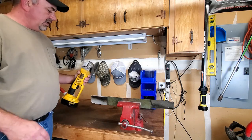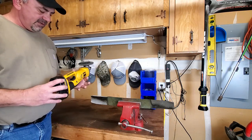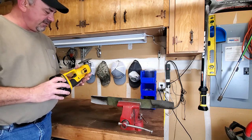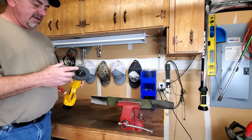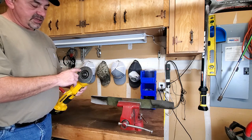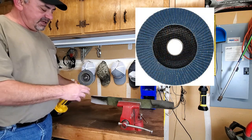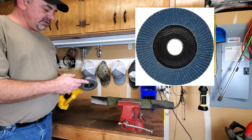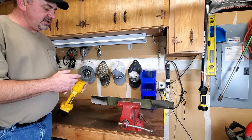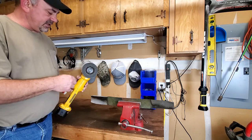To sharpen your blade, I like to use an angle grinder. I have this DeWalt 18-volt battery-operated angle grinder — I've had it for years. The thing you're after is this four-inch sanding disc, a 60-grit disc. It does a pretty good job of cleaning the blade up and getting it nice and sharp. These are fairly inexpensive, about $5 or $6 on Amazon. I'll put a link in the description below if you want to pick these up.